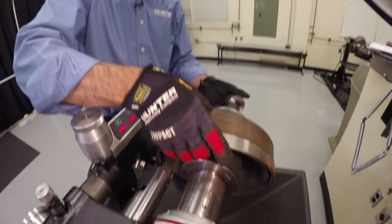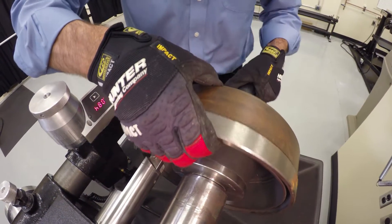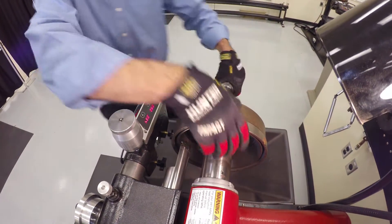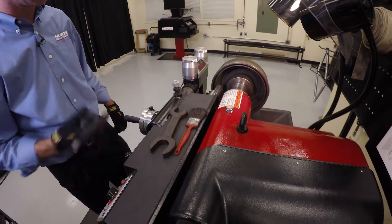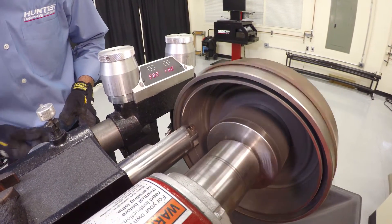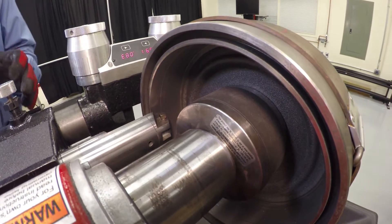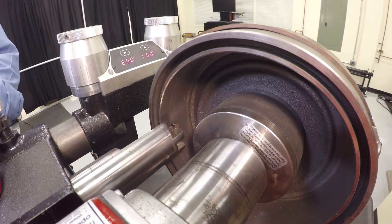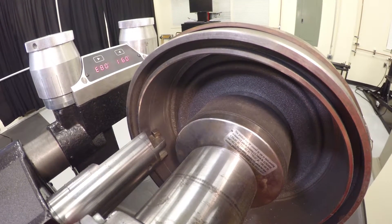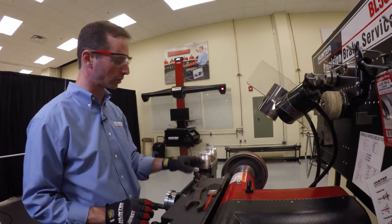I'm going to remount — basically jumble my situation here. Take the cone, turn it about 180 degrees, mount again, and reinstall my quick nut. So we basically just jumbled everything up. I'll turn the lathe back on. I've moved the drum bar out, so now I'll just adjust my cross feed and make contact with the rotor. What you'll see here is that I've made two shallow cuts, and they're continuous all the way around — that basically means I don't have any run out in this setup. Normally you'll see a little bit of run out and two scratches; you want those scratches to be even, about the same length, and right next to each other. In this setup it shows no run out because it's been cut already, so we got a good result. We passed our scratch test.